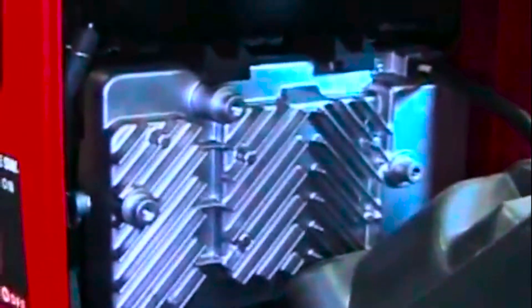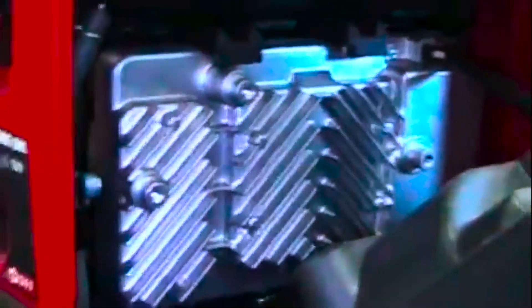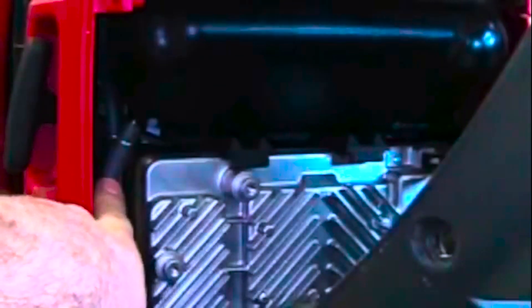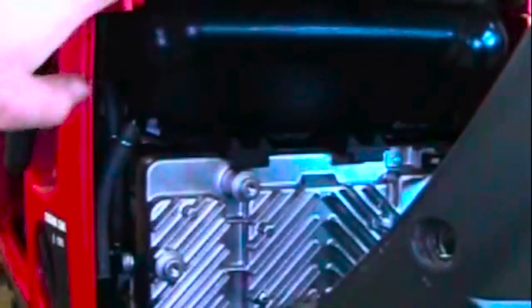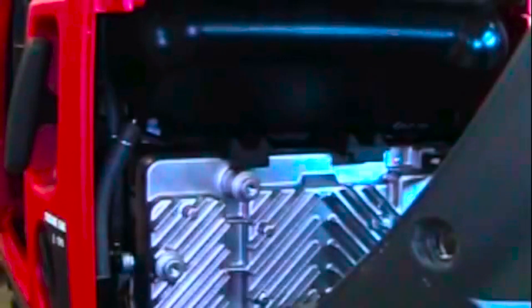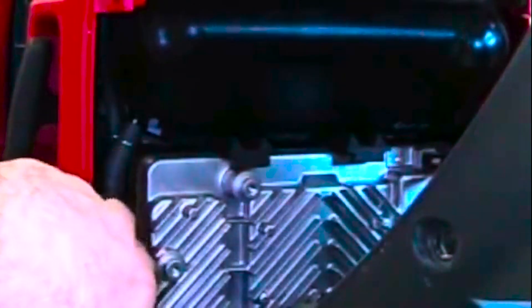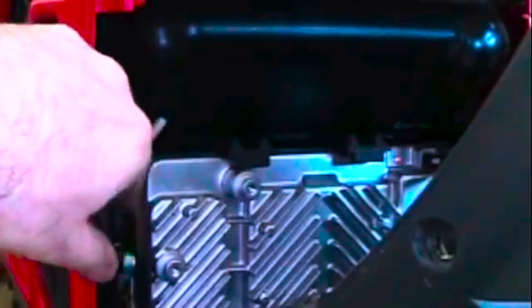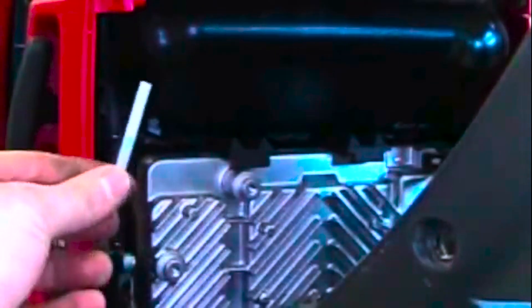Inside you'll have a silver computer box. This is your fuel tank here, and this is the outlet of your fuel tank. You're going to want to make sure that it's drained first or you're going to get fuel everywhere. Just slide this hose off of the fuel tank — I'm not going to do mine because it has fuel in it. Inside this hard plastic part where the fuel line goes over is this finger strainer, which goes right up into the fuel tank. When you pull this out, you'll see one of these come out with it.